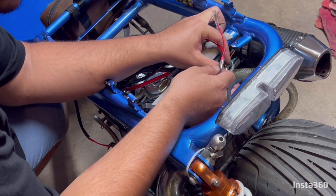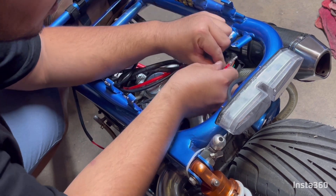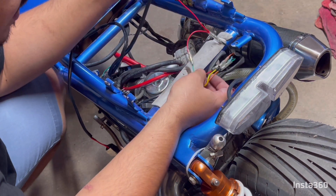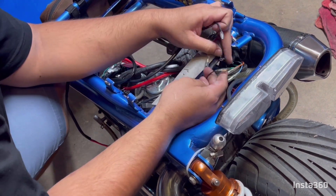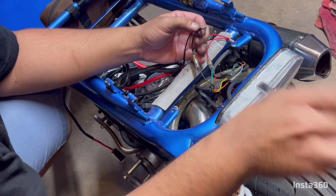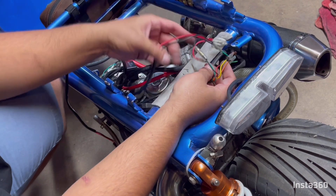I'm going to disconnect it. Green wire plugs into red. This other side is going to go into the black wire on the scooter. Very nice. Then the ground wire — connect this black wire, it's green on the scooter side. Black to black, and then black to green. Now we're wired up.